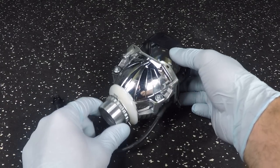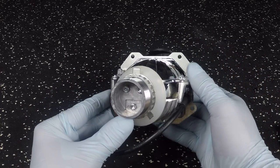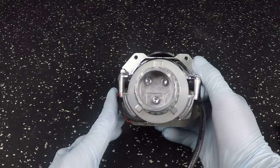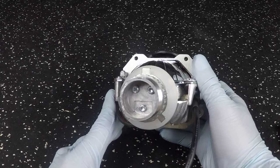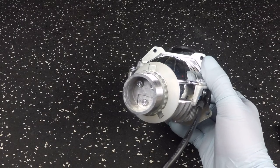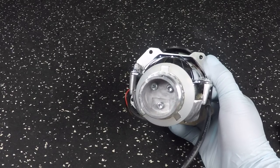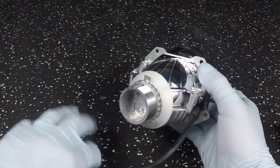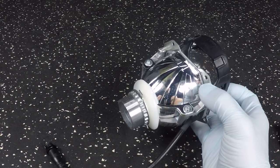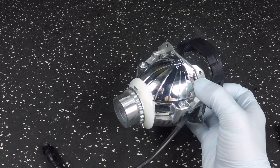You're going to see a threaded shaft — threaded shaft is popular these days. Direct fitment on H4; you can see the H4 adapter right there. It's custom slash threaded fitment on a lot of other models too. You can easily use this in another dual filament application like a 9007 or H13 — you've got to modify a little bit. But also in single filament. A lot of people are doing the threaded shaft method. You put a lock ring on here and you can bolt the projector down to a reflector.